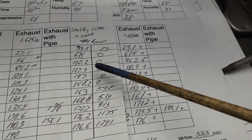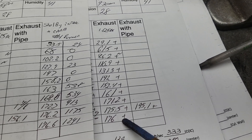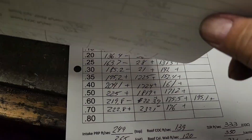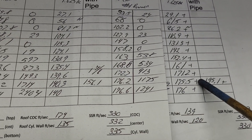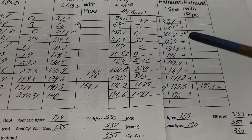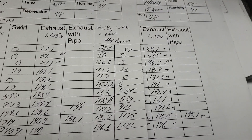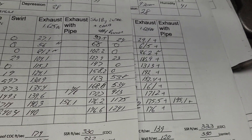In typical Charlie fashion — this is our baseline, this is our first cut. I did much better on the exhaust than we did on the intake. If we take a look at 300: 124 to 142 — a nice step up. We max out at 140 to 175.5 — big step up, huge. How do we do with a pipe on? 156 to 195 — we're almost there. It's a good thing too, because there's not a ton of metal in there. I can't just reshape it the way I'd like. Remember, it's already big, so we just have to get the airspeeds where we want them and send it.